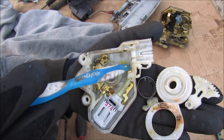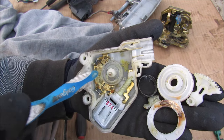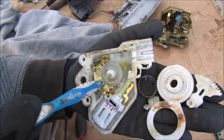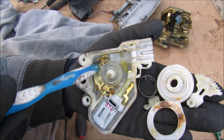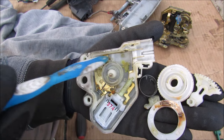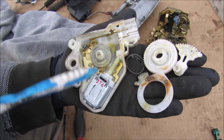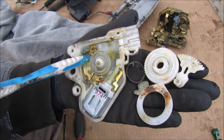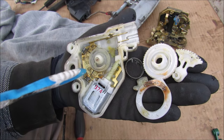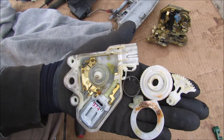To unlock, positive polarity is sent to the other side, going through the motor and diode. As long as the piece is in the locked position the gap is bridged, turning the motor to spin the gear the other way. The gap then moves, bridging the other contact and creating an open circuit that stops the motor in the unlocked position. The reason for all this circuitry is to prevent the motor from overheating - you can't lock a locked door or unlock an unlocked door. It presents an open circuit if the voltage commands movement in the direction it's already in, acting as a stopper so the motor doesn't grind.